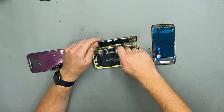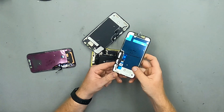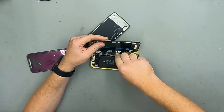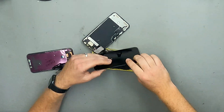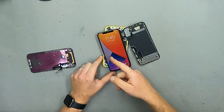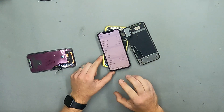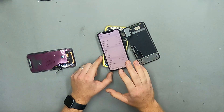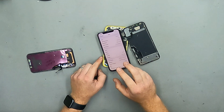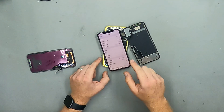I'm going to disconnect the battery and the screen again, and now connect the aftermarket screen with an IC which is either blank or just has zeros on it. If this behaved in the same way as the refurbished screen it should show a notification, but as you can see as it's booting up there is no notification on the lock screen. If I go to Settings > General > About there is no notification there either. What suppliers discovered a few months ago is that if this IC is either blank or just written with zeros, this is a sort of iOS bug where iOS does not recognize the display as not being the uniquely calibrated one.